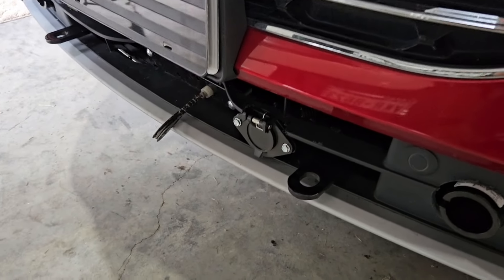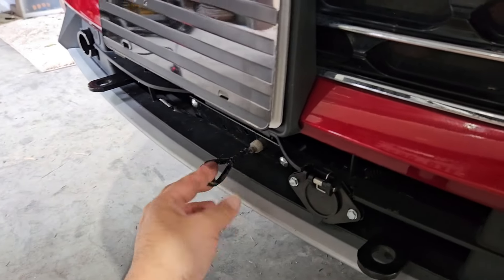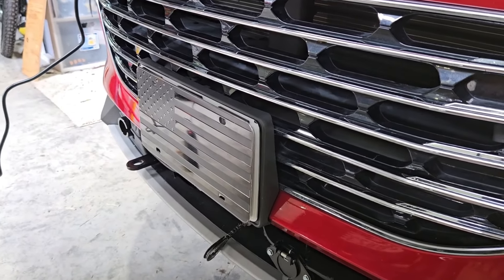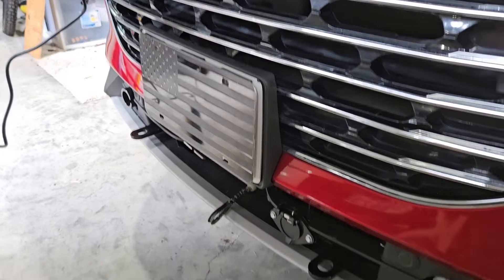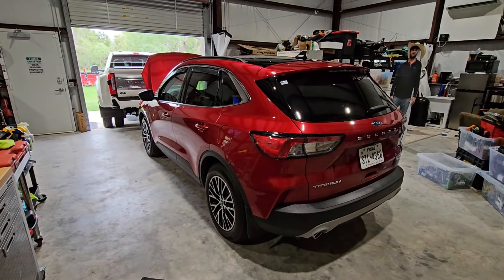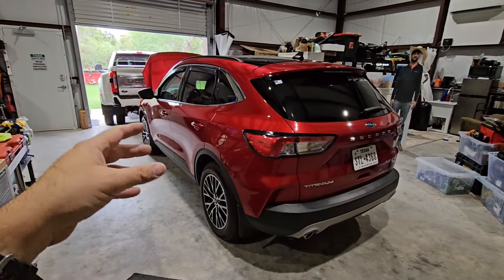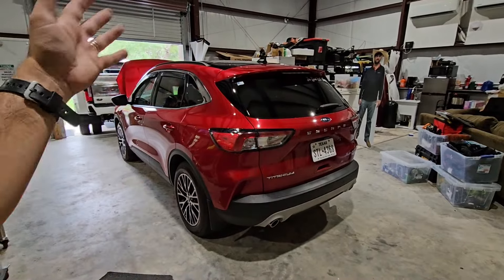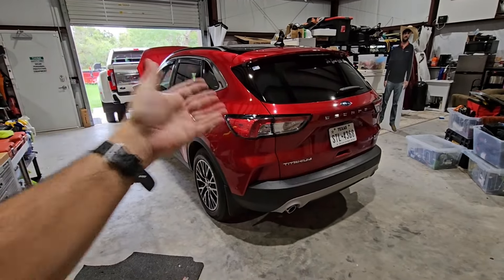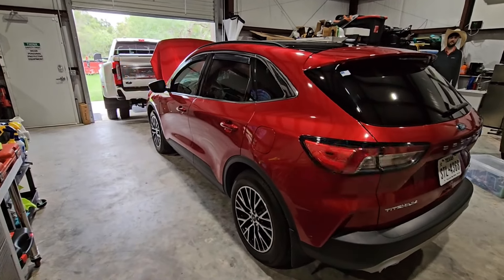In case you wanted to see what the plug looks like up front - it looks really good, nice and clean. We have our base plate mounted, our brake actuator right here, everything's looking really good. This thing is ready to be flat towed - we just have to do the RV side now, which is really just setting it up with the receiver and plugging the cable into the seven-way connector on the back of the motorhome.